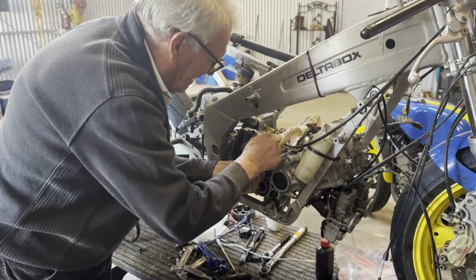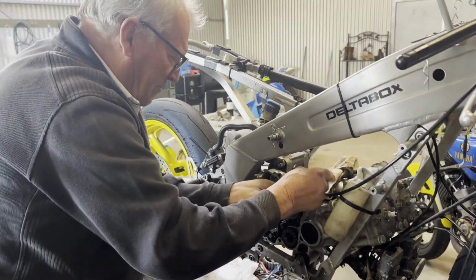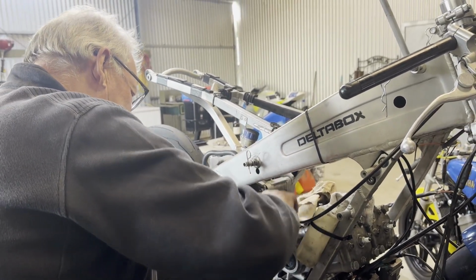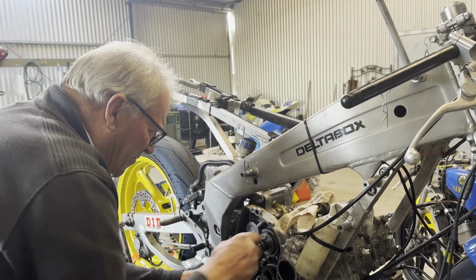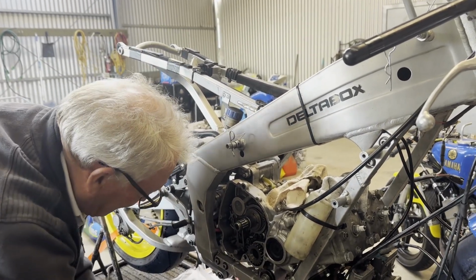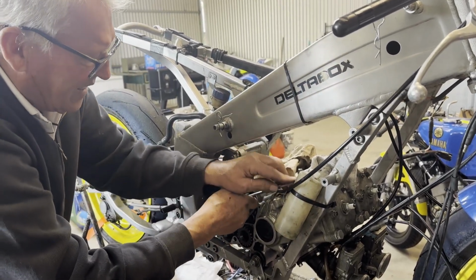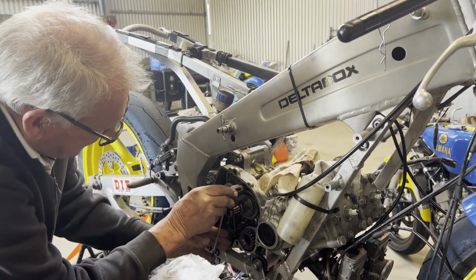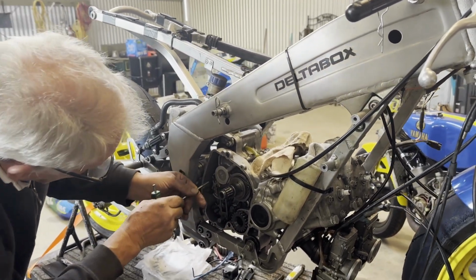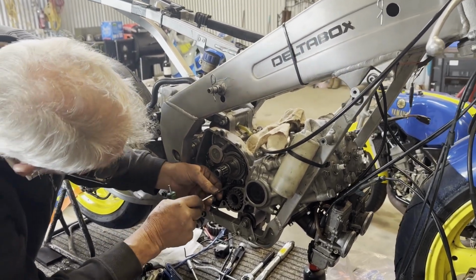Yeah, it's something I haven't really looked into yet. Changing internal gears. I normally work on the final gearing, like on your chain and sprocket, but when you really dial in the bike for each track, you can change the internal gears to suit each corner. So once I get better at it, that's the next step I'm keen to learn and practice.